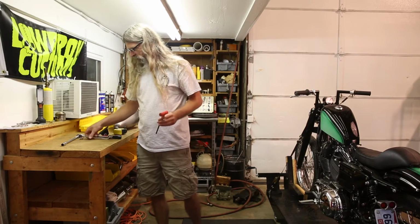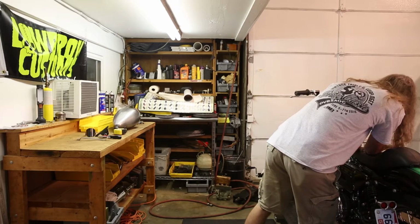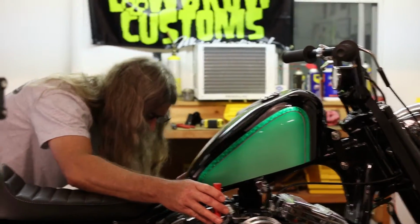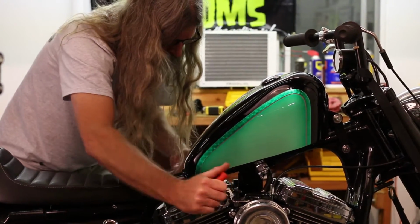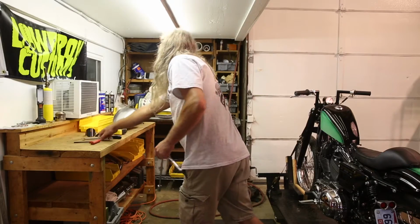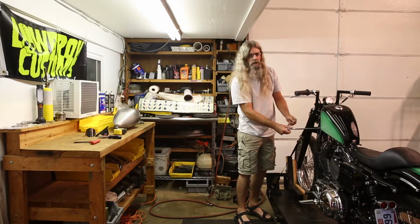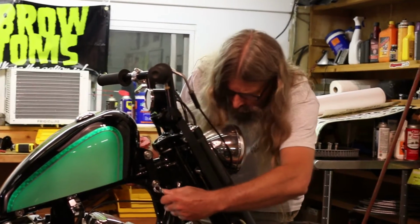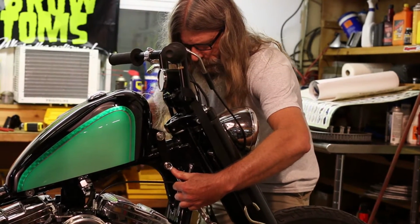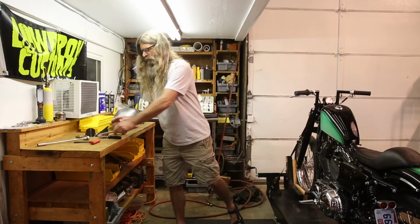Okay, I've got a 1/4 inch Allen wrench and a 1/2 inch drive socket. Stock fasteners will have the 1/4 inch hex fastener. The front one on this has 1/2 inch on both sides. The fastener's been replaced. This particular gas tank that's mounted on the bike right now has our gas box tank lift kit installed. Your stock hardware from your motorcycle will work with the adapter brackets.